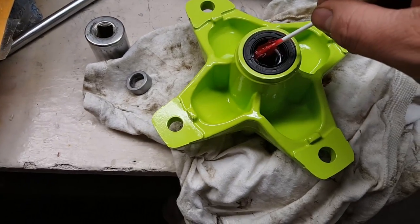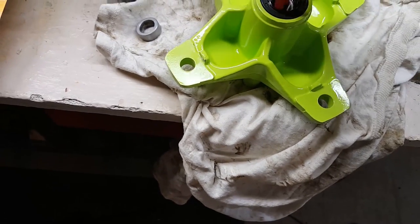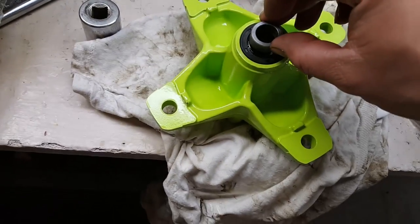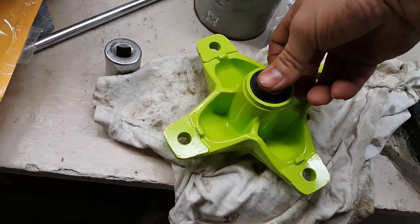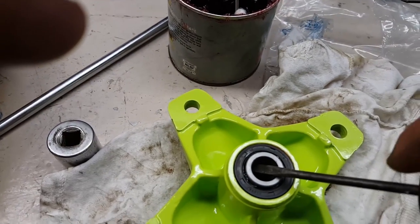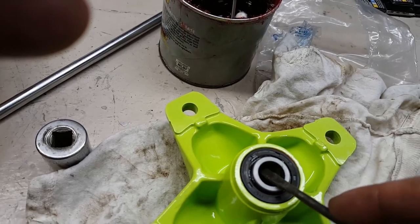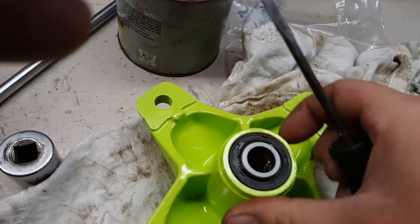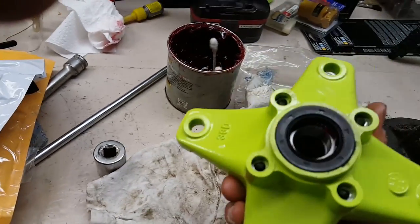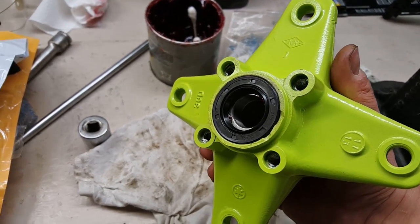Real quick guys — don't forget to put your spacer in here, and just put a thin coat of oil on the inside of your seal because there's going to be friction in there. Pop this in — don't forget to put that in there. Usually it pushes in pretty easy, and then sometimes you just have to pull it out a little bit to make sure that your edge is sealed in here. There we go. And before you put your hub on, grease the inside of this one too, because the spacer is actually a part of the spindle.